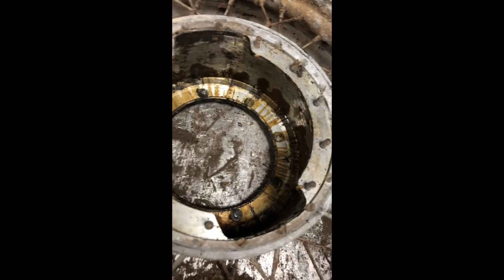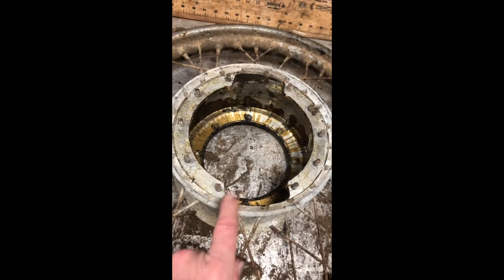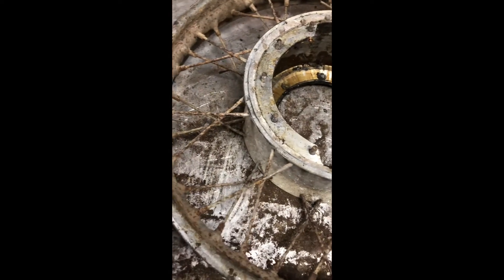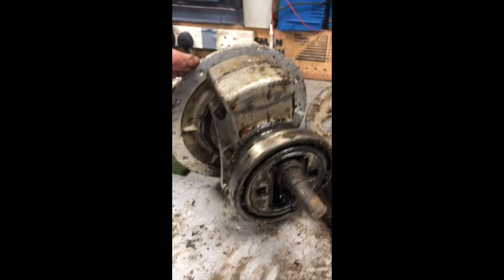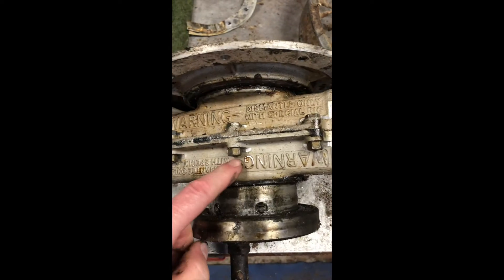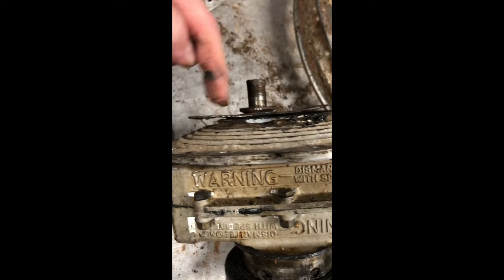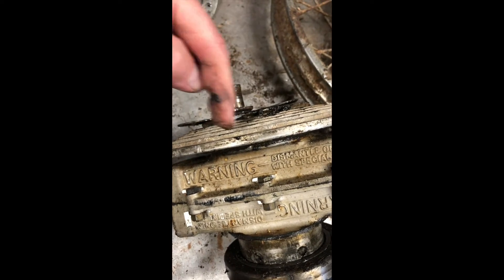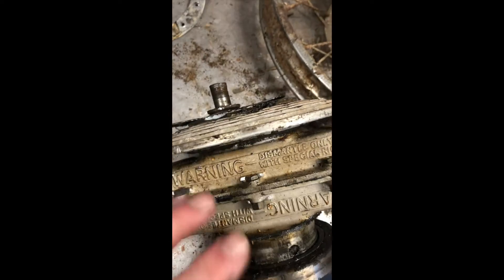You can see it's a very simple setup. One of the things you do have to notice is that the cutouts are on an angle — they're not directly opposite each other — because of the way the sprung hub works, which is here. You can also see it's on an angle. The important thing here is that there are springs inside this unit that allow this axle to move up and down, giving you some suspension movement actually inside the wheel itself.